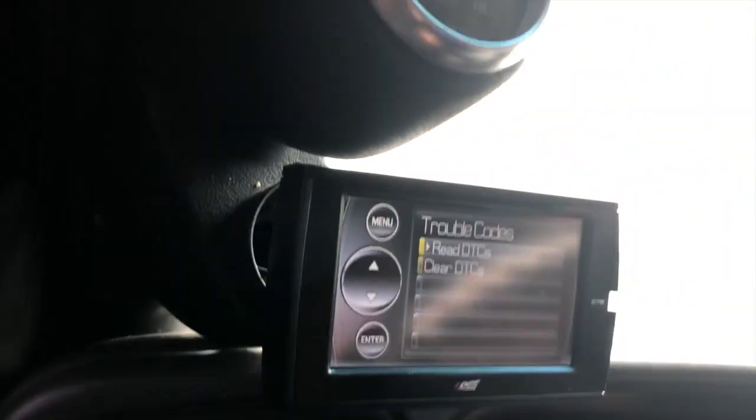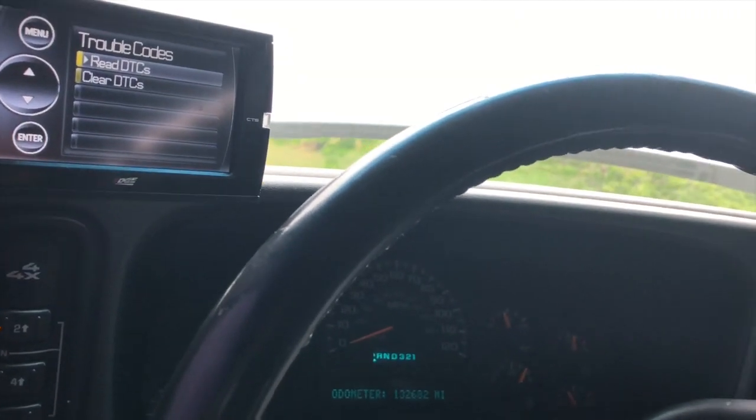No codes - I've cleared the code and this truck has never really given me issues; this battery thing is just kind of a pain. In Florida I drive the truck so often I wouldn't notice the battery dying because I drive it every day - it would only die after three or four days of not driving. Up here in Michigan I drive the Maverick and my parents' Yukon more, so the truck sits longer and the issue was more obvious. Ultimately you don't want to see your battery below 14 volts at idle - that means your alternator is getting outworked. I think that module was drawing over 150 amps, and the alternator only puts out 145.